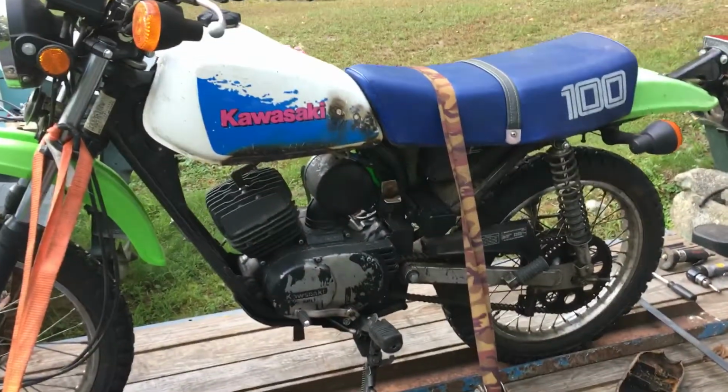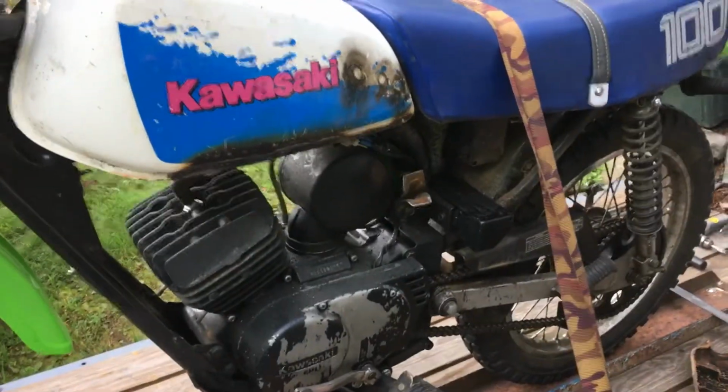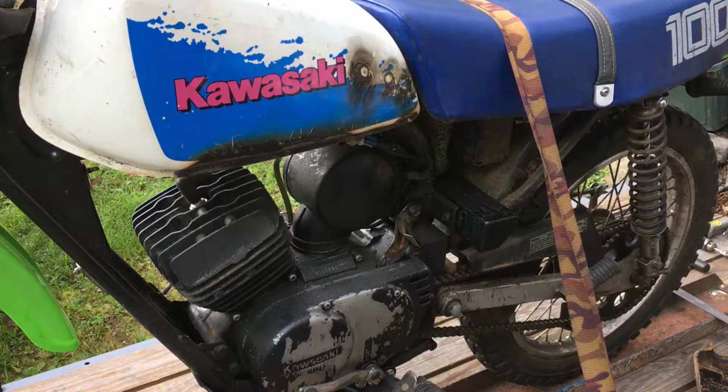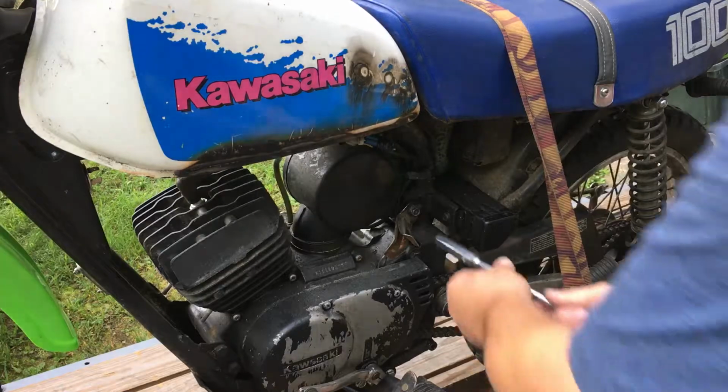Alright, so now we're at the part where we remove the exhaust and he's going to do a finish weld. He's going to get it all braced up so he can do the weld all the way around it and complete the circular part. While he's doing that, I'm going to remove the remnants of that bracket that I cut off the other exhaust, because we're not going to use that. It was a good idea, but the chamber is going to be fitted into that cavity right there, so it fits in there nice and snug.